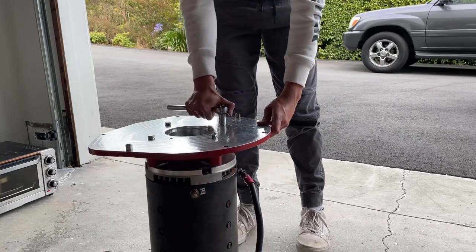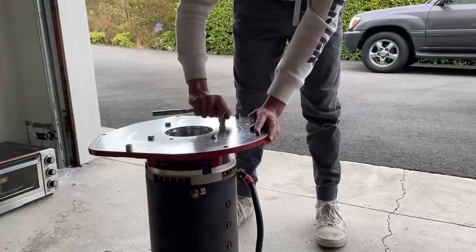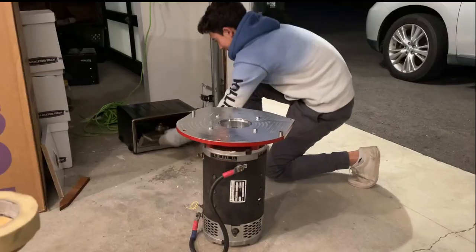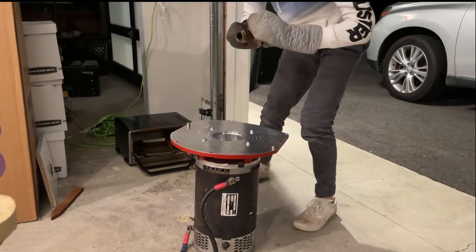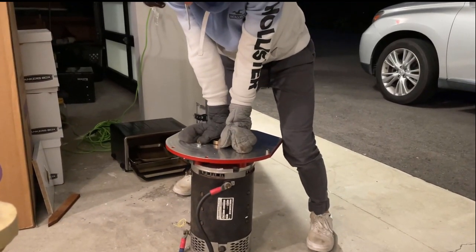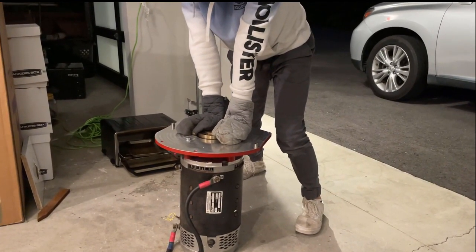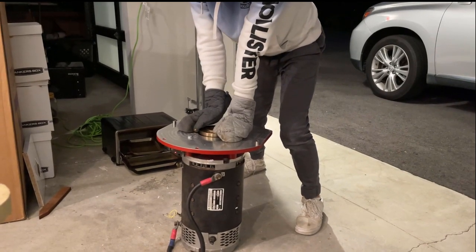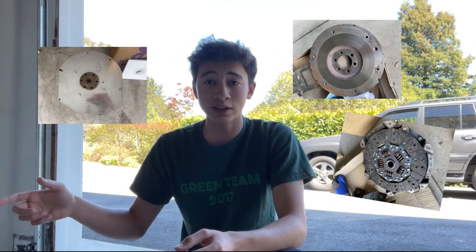After the adapter, I'll be mounting the flywheel. Here I'm taking the flywheel hub out of the oven — I have to get it on pretty quickly because it's hot, and you'll hear a loud clank when it goes on. And then it's on. I just hold it for maybe 10 to 20 seconds to make sure it's seated. Now we can attach the flywheel and clutch to the motor adapter and then use that to mate the motor and transmission.